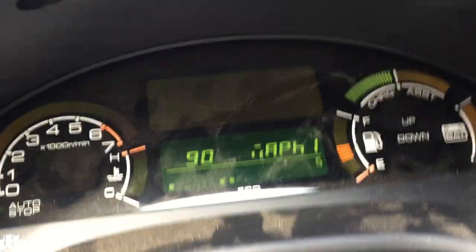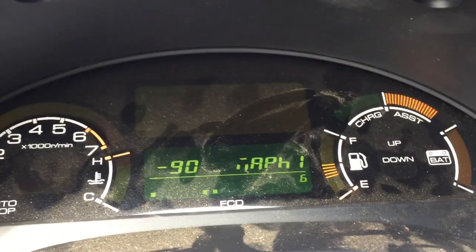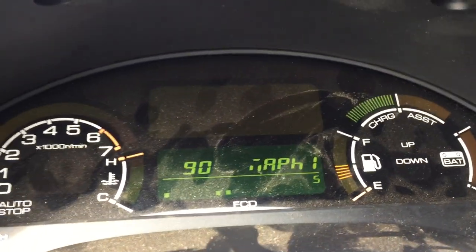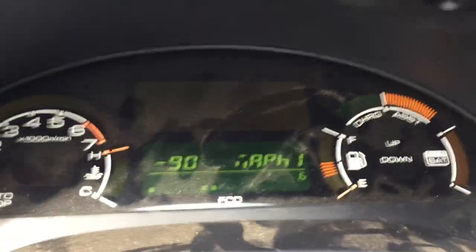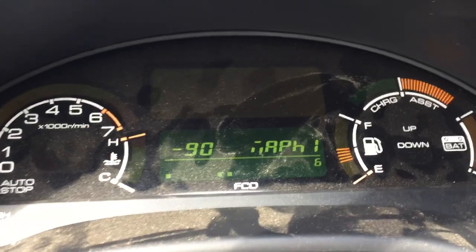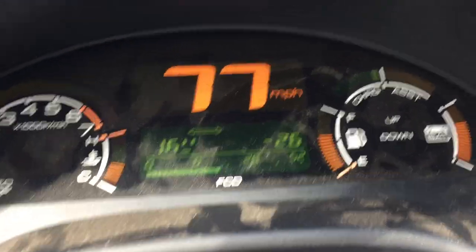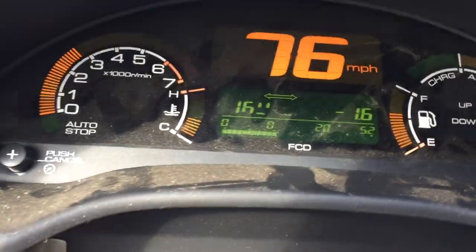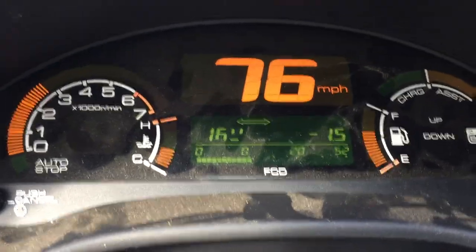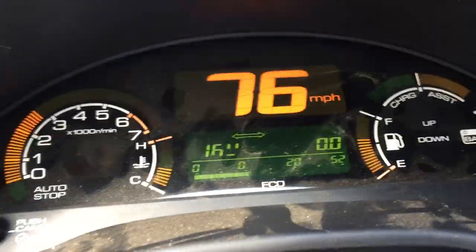So on the other display, the assist, so the charge is 0 to 90 amps positive. Well, the assist is just 0 to 90 amps with negative, so 0 to negative 90 amps. And that way, I can use the same mapped parameter value and get a true charge assist. So I haven't found that I'm actually changing what a lot of the parameters are here, which I'm sure a lot of people will do.